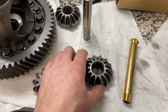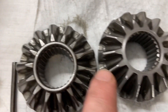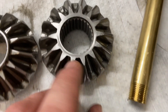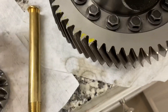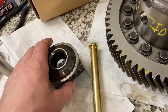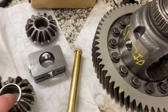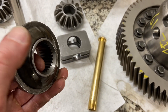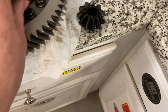Here are the gears after machining. With the axle gear, you want to take all of this casting and get rid of it. There's an arrow and some numbers — basically took that right off. You can almost see the very tip of an arrow that used to be there. You need this to be flat so that when it goes inside, it has full contact with the LSD. These also have the clutch plates on here — they might fall off, so just make sure you have them on there when you put them back in.